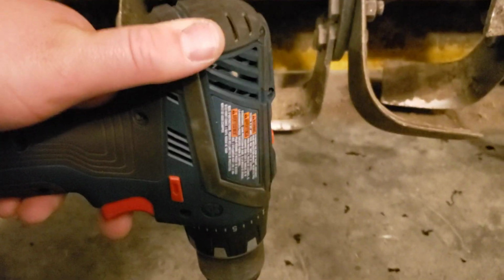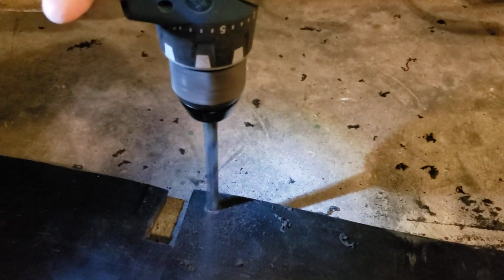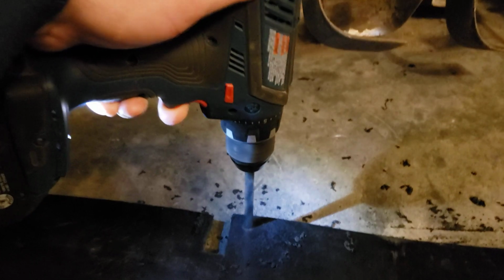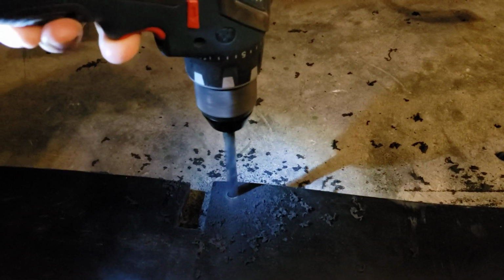Guys, so I wanted to show you how easy it was to drill through this rubber. I'm on this hole, so you can see. I've just used my estimation skills to bring those holes in just far enough. I'm sure it'll be fine. If it's not, we'll just open the hole up. But I've got this hole started so I can do it with my left hand, and I have a nut sitting underneath it to hold it up. And then I had that over there on the other side, the big crescent wrench. High speed, hardly any pressure, just let it cut. Don't force the bit because then it'll make the hole floppy, and there you have it. And then run it after you're through. Nice clean cut.